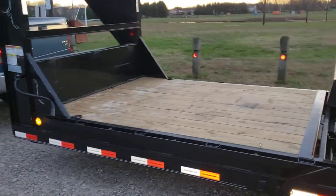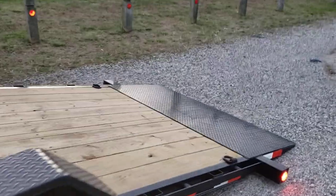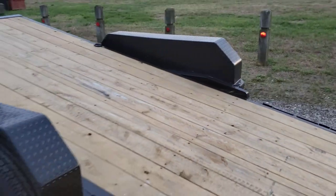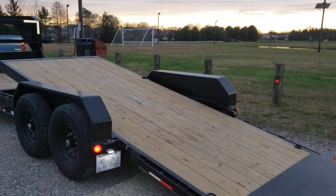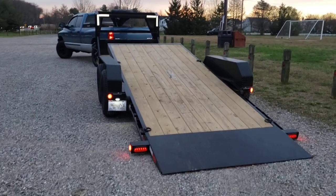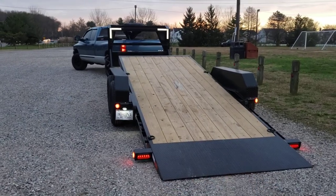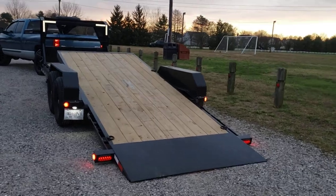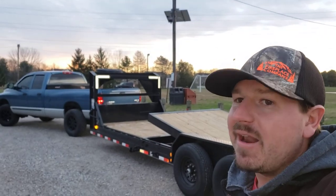Some shippers might not be real pleased about it — you could clearly load pallets and forklift-load anything on the stationary deck and the front half, but some shippers might not be thrilled about having to work over or around the fenders. That said, you could always lower things down between the fenders, or do the old pallet slide — put one pallet here, get the next one in line, push it forward, and work it that way. That's a limiting factor I was willing to sacrifice to have the option to haul equipment and cars as well as freight, without messing with ramps.